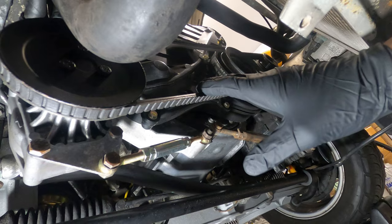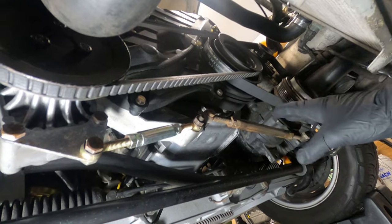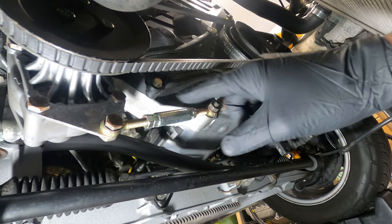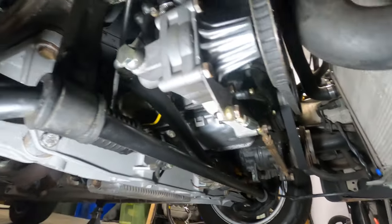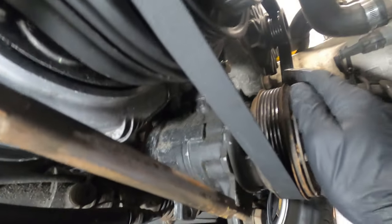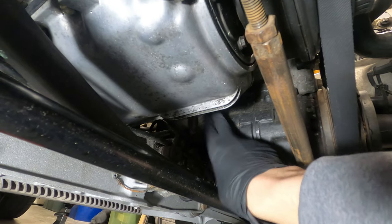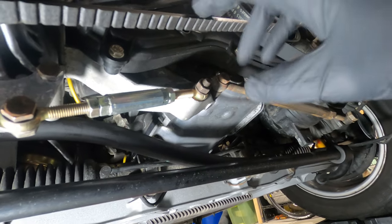Below the car, you'll find the V-belt for the power steering pump and the ribbed belt for the AC compressor and alternator. There are two tensioning rods that need to be released. The power steering pump has two 13mm and the AC compressor has two 17mm. You'll need to release the pivot bolts on the mounts, one in the front, one in the rear. These are 13mm. And then on the AC compressor, there is a 17mm up front and a 13mm in the rear. Release those first and then detension the adjustment arms and the belts can come off.